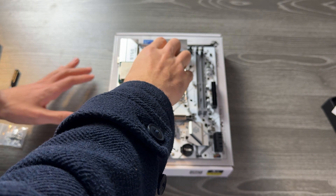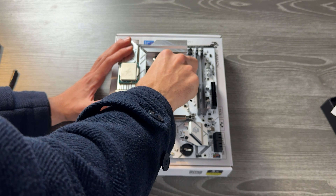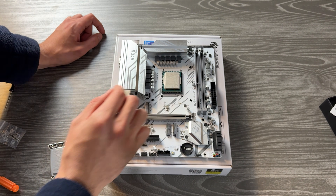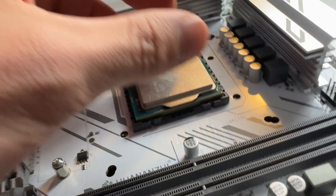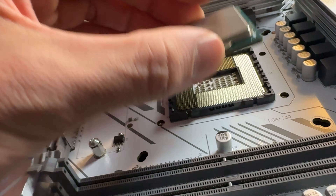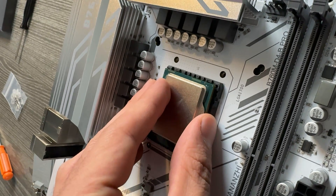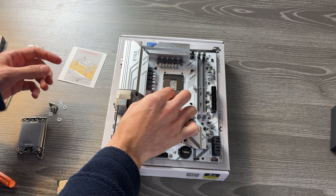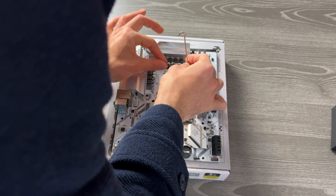How does it work? It's plug and play, but not really. They sell you with two screwdrivers. What you need to do is unscrew the socket on your motherboard — if it's your first time building a PC it may scare you a little bit, but trust me, it's very simple. You basically unscrew the four screws on the socket before installing the CPU, take them off, put two washers on the holes, and put in the new screws they give you with the CPU. They literally give you two screwdrivers, four screws, and eight washers. You mount it back and that will lift up the socket a little bit, and at that point you can go ahead and mount the CPU.